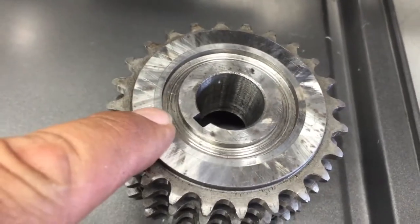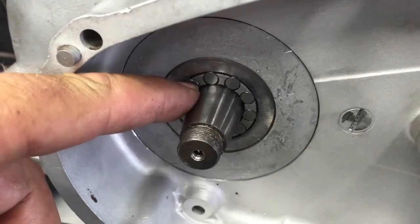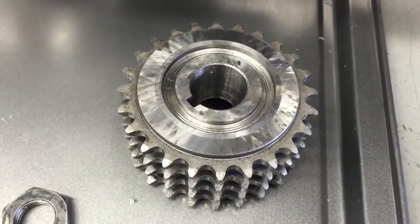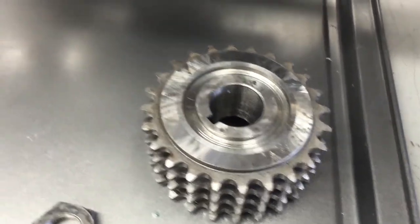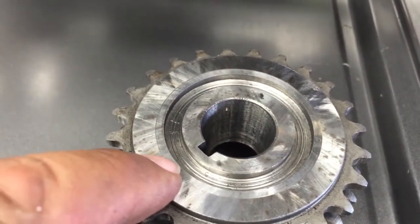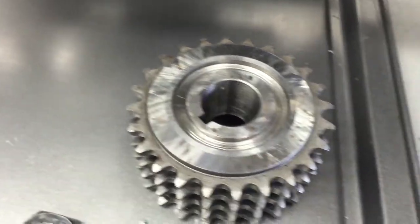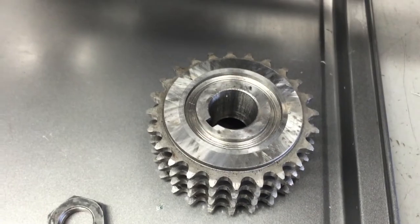Originally the engine sprockets had a cork in here — whenever we do a motor we upgrade this to a seal. It's a little bit hard to do it after the fact in this case. But the cork washer — I've actually found it doesn't do anything. Don't even bother putting it in — I haven't put them in for 20 years and haven't noticed any difference whatsoever. You've got to be careful with the cork washer because if you do use one, it actually has to be sanded down so it's just proud of the surface of the sprocket, otherwise it'll lock up a motor. For safety, you're just better off not to use them — I've seen more problems created from them than what it's worth.